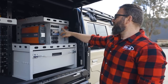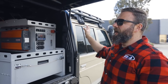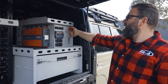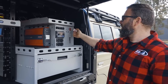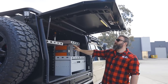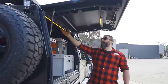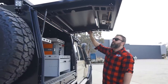One of the other features is the battery in here is basically Bluetooth, so you can connect to it via your phone and see what your battery's doing. It's currently showing 99% state of charge and a discharge amperage of 1.9 amps because we've got the lights on. It tells you your voltage, battery level, current draw, temperature, and the amount of cycles — a really simple way of keeping your battery system simple but with all the features of more advanced systems. There's also a solar input, so if you were parked in shade under a tree with a solar blanket, it's as easy as pulling it out, connecting your blanket, and putting it back in the sun wherever you need. This canopy is also running Hardcore LED lighting switched from the Powercore X unit — a 450mm strip in the door and a metre-long strip in the body which can be changed from orange to white just by pressing a button.